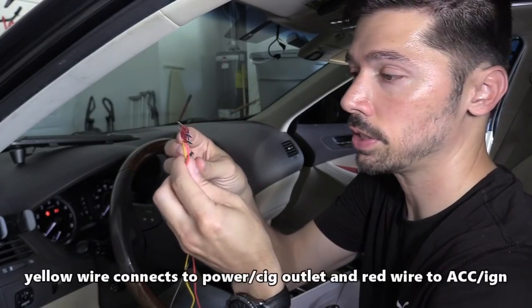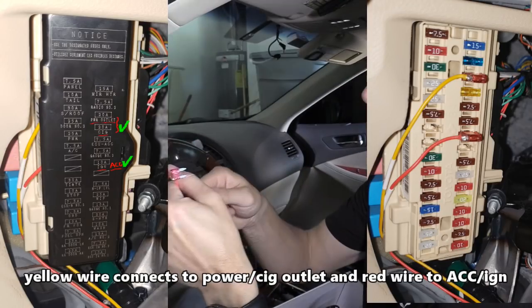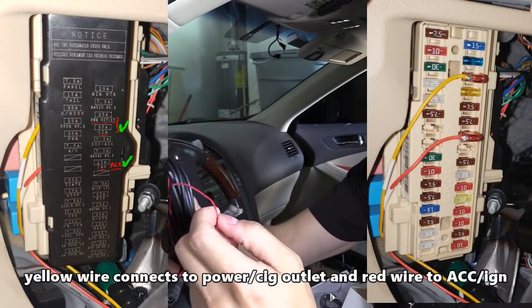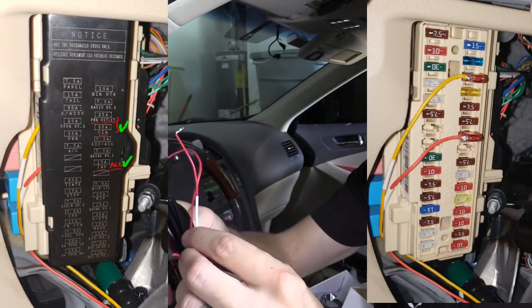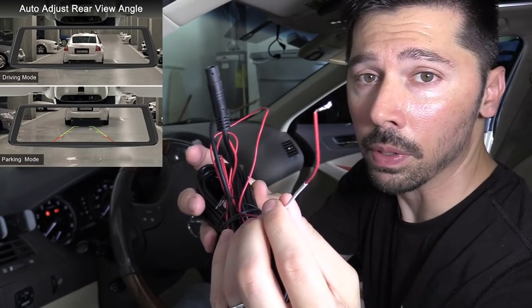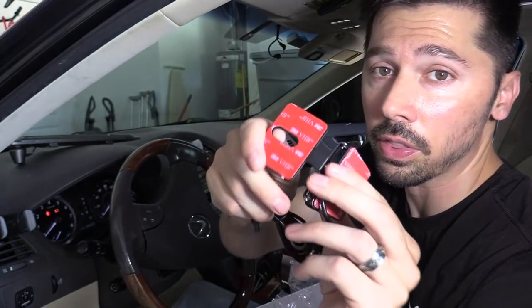The kit has connections already for the fuse box — this connects into your fuse box under your dash. The red wire is for your ACC when you turn on the ignition, and the yellow is for your 12-volt line. These wires connect to your tail light, which triggers the backup lines. Here's your backup camera, and it has 3M tape which is weather resistant. Make sure you clean the surface before you apply the 3M tape.